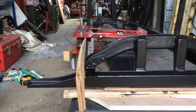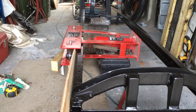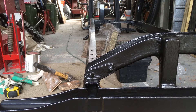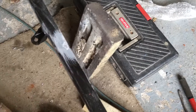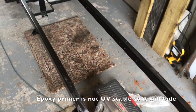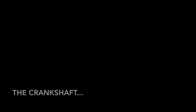I reckon over-bending it and checking it should do quite nicely — I should have a nice straight chassis rail now. I seem to have over-bent it somewhat and got a slight kink in the chassis rail, so I had to get that kink out, and that is now straight — straight enough for my intents and purposes. That jack system did it quite nicely. Of course it means I've damaged my nice paint, but I've got to put a top coat of black enamel over this black epoxy anyway, so I'll just have to repair that little bit.